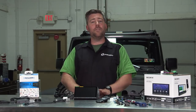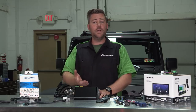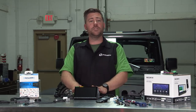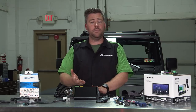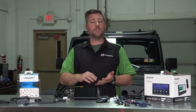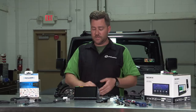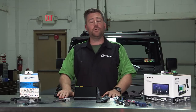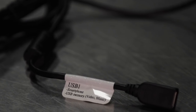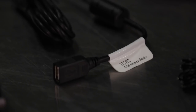On the back of the unit, we have an input for a rear backup camera that makes backing your Wrangler even easier, and there is some customizability where you can change some guidelines which will make backing into a parking spot easy. There are also three 2-volt preamp outputs for connection to external amplifiers for front, rear, and subwoofer speakers. And we have two USB inputs on the back of the unit as well — USB 1 for smartphone connection, while USB 2 is dedicated for music files.